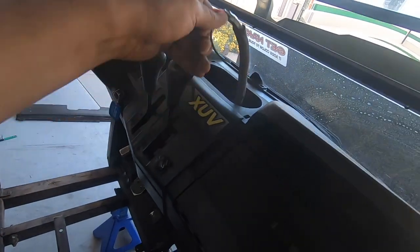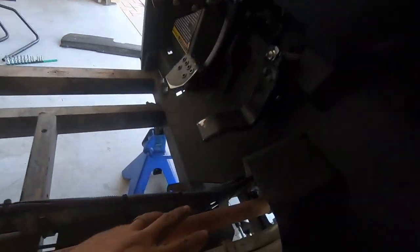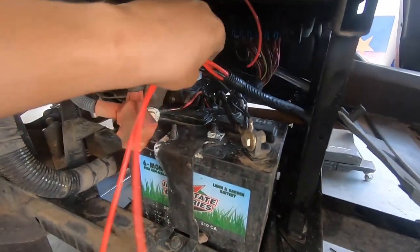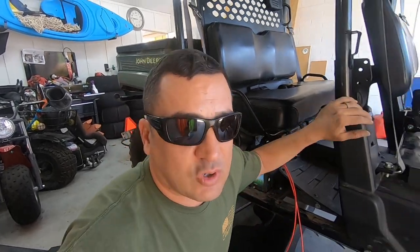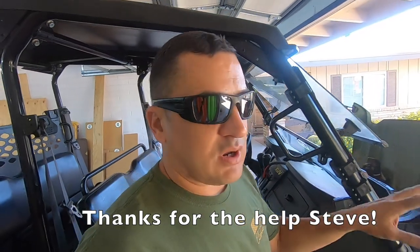The hard part is done — the wires are run. I currently have them coming out just right here. We're going to have all the indicators up there going down the dash, connected to the factory wire loom. These two longer wires right here are 12 gauge going to the rear so we have less voltage drop for that 12-volt pump and the rear lights. I also have a new battery to go into this thing because this one is pretty corroded and not holding a good charge. Next step: strip the wires, put the switches in, and run power to the front.